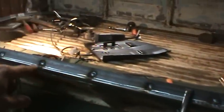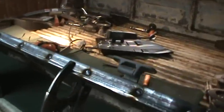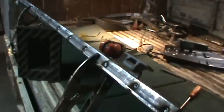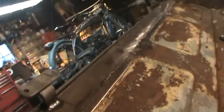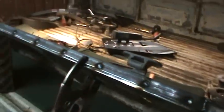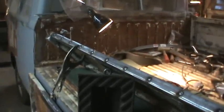I got that all cut up, drilled, plug welded, and sealed the ends up. It's a little janky — the bottom edge is not exactly dead nuts, but when you're cutting for 15 minutes you kind of lose focus a little on your line. But I'm just going to run seam sealer on that so all that should disappear. This is the money shot — that reveal. I'll pop that on the truck in a minute and see how it all looks. While it's still up in the air, I'm going to hit it with a flapper disc and knock those welds down.